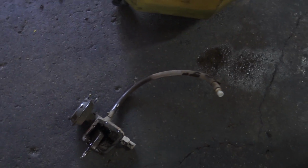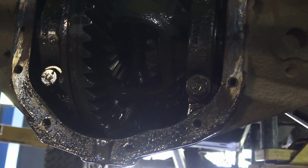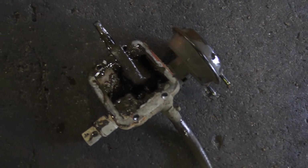This truck wants to be a two-wheel drive really badly. Man, let's see if we can find something on the web. Well, the project truck is slowing down. Front differential, I thought we had to just replace the actuator for the four-wheel drive where it slides on the axles. But when you pull the pin, it's just like mud coming out of there. Not a good sign. And the actuator itself, the fork's bent, worn out.